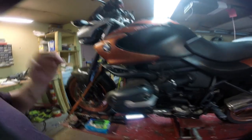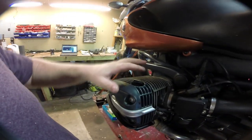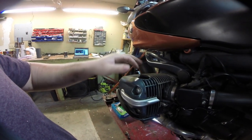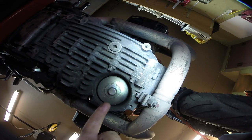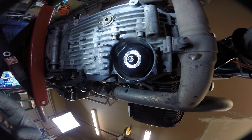Let's start with the oil change. The bike's already warmed up, rode it around a little bit. Your oil fill is right here, top of the left-hand side head — you just unscrew this plug and that's where you fill your oil. Underneath the bike, right here, there's an oil filter. We're going to remove that, drain the oil out, and then there's an oil drain plug right here. It takes a number eight hex bit to remove the drain plug. I use K&N filters — not because of any sponsorship, but simply because they have a hex nut on them which makes removal on a bike like this really easy.